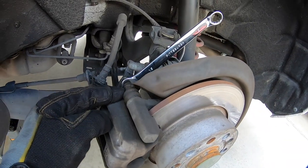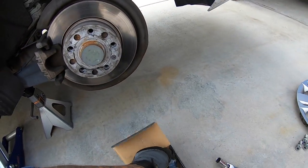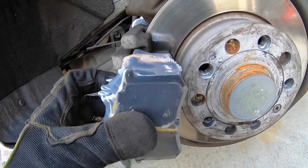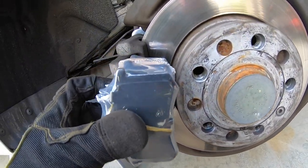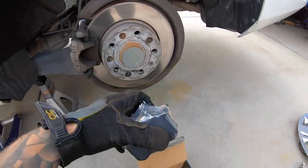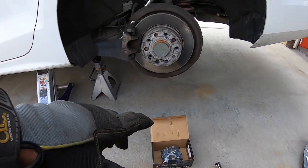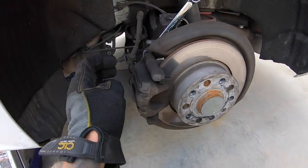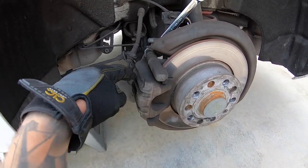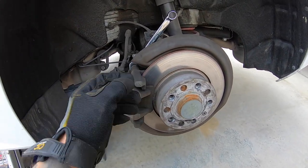Find out what sizes you need — in this case the caliper bolt is a 13mm and you're also going to have to hold the pin, which is a 15mm. One last thing I'd suggest before taking everything apart: check whatever pads you order to make sure they're roughly the same size and shape, because the last thing you want is to rip this whole thing apart and find out you have to go back to the store. I'll link the ones I use in the description below. Once we get this off I'll show you the special tool you're going to need, because you need something to drive the piston back in on these types of rear brakes.